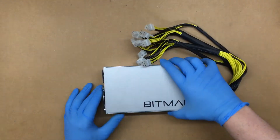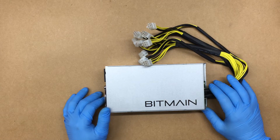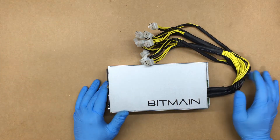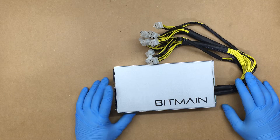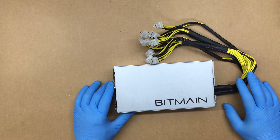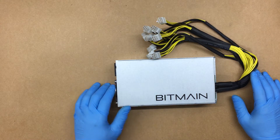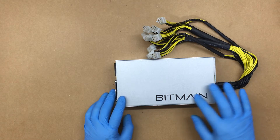When you want to power this, you definitely want to use a very heavy-duty power plug. The one I have is a 12-gauge pre-made cable. You definitely don't want to run this on something lightweight like an 18-gauge plug — you're asking for issues. It's also not recommended to use an extension cord, which would probably not be very good.